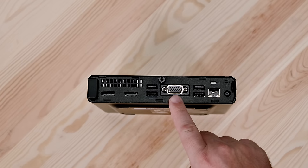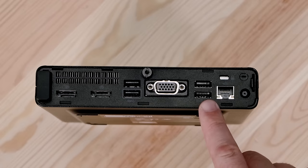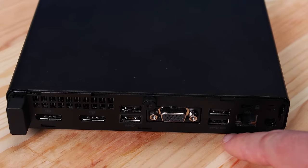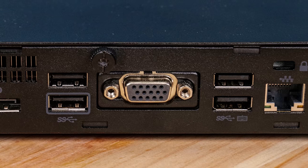Flipping the system over, we see a fairly standard layout. We have two DisplayPort 1.2 ports. Our system also has an optional VGA port — this is optional and there are different options that can go here: blanks, VGA, HDMI 2, or DisplayPort. On the rear, there are four USB 3.1 ports, and the labeling makes it hard to tell them apart. The USB ports on the left side and rear are USB 3.1 Gen 2 ten-gigabit-per-second ports, and the ones on the right side are USB 3.1 Gen 1 five-gigabit-per-second ports. HP does an atrocious job of labeling these.